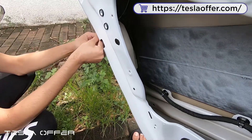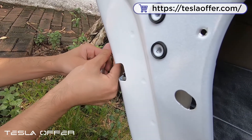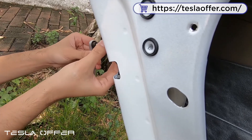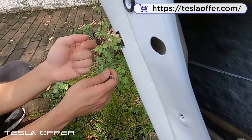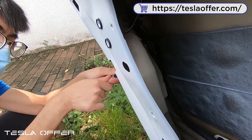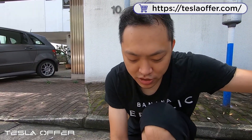So now we are removing the door lock. These are held by three T20 screws, so just loosen them all. The rear door lock is super easy to remove because the whole cavity is here — you can just pull it out after you remove the screws.